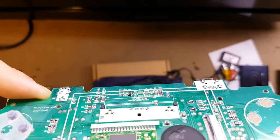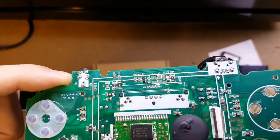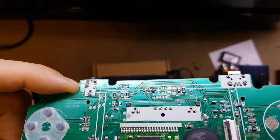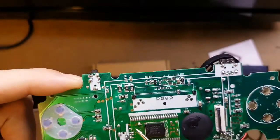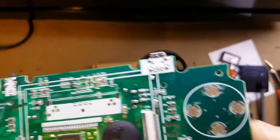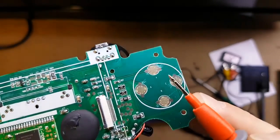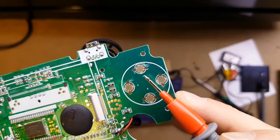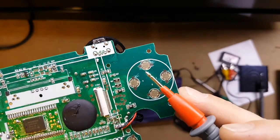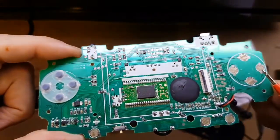Just having a quick look to see if there's any questionable joints. There's no actual brains of the thing — it doesn't appear to be. This has clearly been hand-soldered on — there's loads of flux residue. It does look like they've had a good clean-up of the contacts for the switches though. I don't know whether the solder mask was applied and they've had to take that off, but it does look a bit scratched and such like.